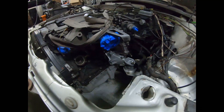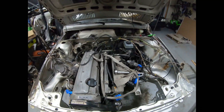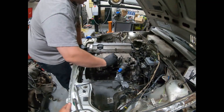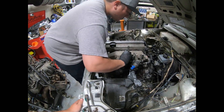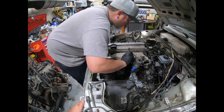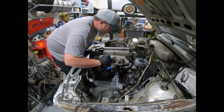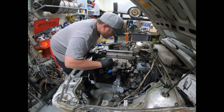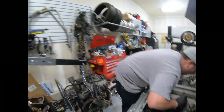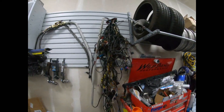Thanks for the GoPro clip — I'll probably use it like this, I'll be honest. That feels so rad. Now we're pulling the old AAN intake manifold off. We're gonna have to build the water manifolds, try to use the AAN one and weld in a fitting, and we're gonna fit the BST manifold tonight.